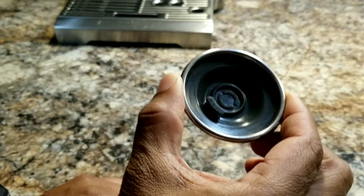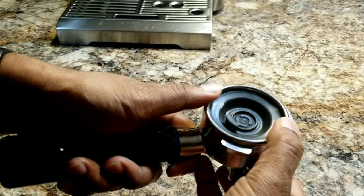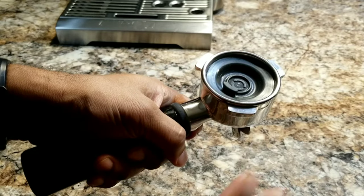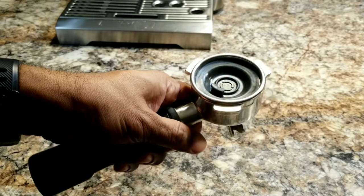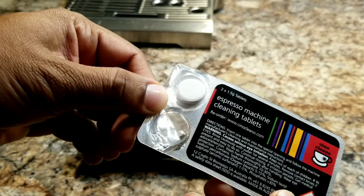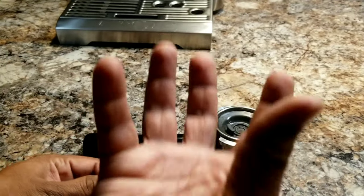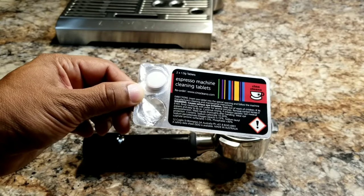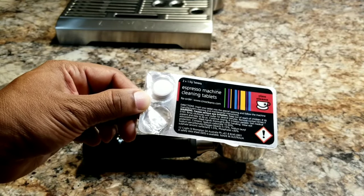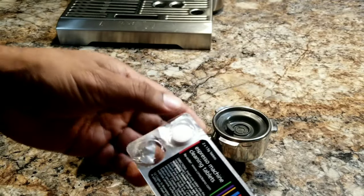Now, the second step is to place the filter basket into the portafilter. So you take your portafilter and insert it. Now, the third step is to put the cleaning tablet into the filter. You'll find the cleaning tablet in your cleaning kit again. If it's new, this is the one I'm going to use, the Breville tablet. You can buy this online from the Breville site. It comes in a big packet, or you could use any third-party tablets from Amazon. Both work well. I'll leave the link in the description below. Anyway, I'm going to use the Breville tablet.